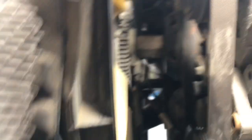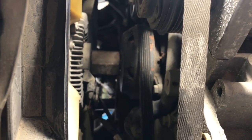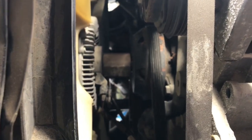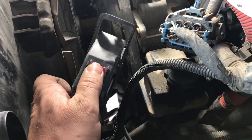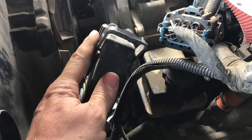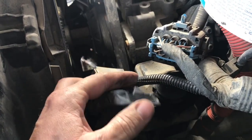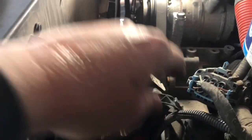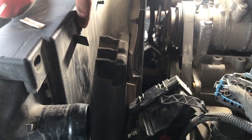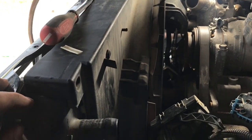The TCM is still in the way, so I've got to move that. I just started on this yesterday and then got distracted — this is an after-work, multi-day project. Probably got a week just getting it apart since I've only got a few hours after work. This is the TCM plug: you have to release the red tab by pulling it up, then this one here flips down and you flip it up, and it just pushes it out of the TCM. The TCM is held on by a plastic clip here and a plastic clip there, so I got that out of the way and into a safe spot.